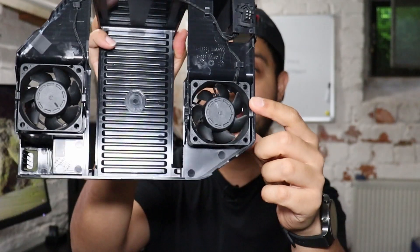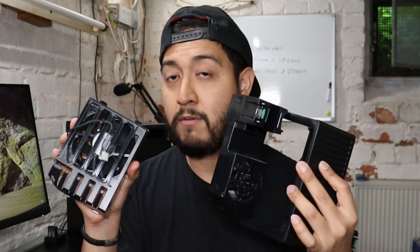I'm going to explain why these upgrades can be very cheap and a good solution if you really want to keep upgrading your workstation. I'm also going to install the memory fan cooling solution, which has two fans. When you have this kind of workstation it has four channels and up to eight slots, and when you populate all eight slots with memory modules it gives you a post error at boot recommending, not mandating, that you have the HP Z440 memory cooling solution to avoid any heating problems.